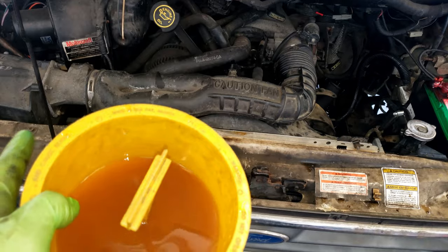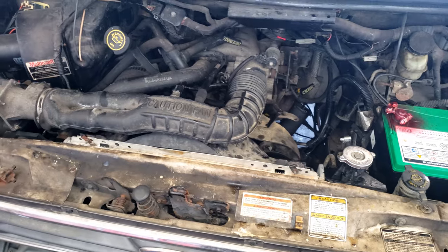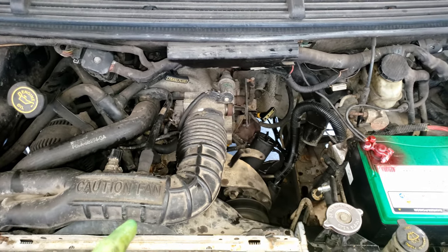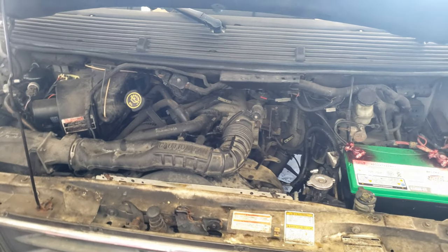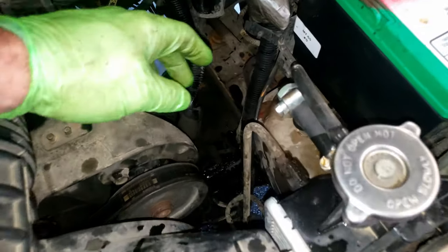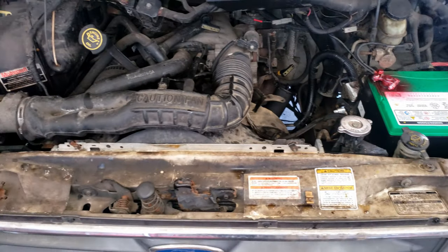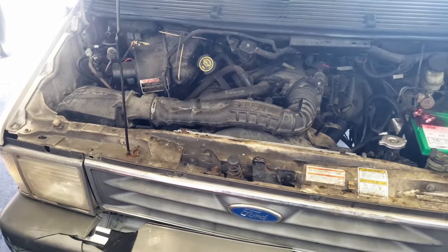Then put your radiator cap on. You can see the coolant still has an orange color even though it's two and a half gallons of fresh coolant. The customer didn't want any additional flushing or labor, so we're going to leave it as is. Don't think he's going to have a problem with that new pump — this thing's got 195,000 miles on it. Don't forget to top your reservoir bottle off too, bring that up to the high mark, and you are done. Go drive it and make sure it doesn't overheat. That's how you replace the water pump in a 1997 Ford Aerostar with a 3.0.